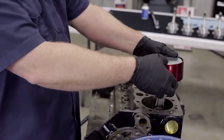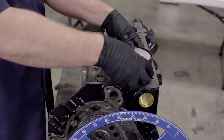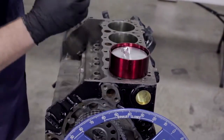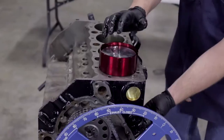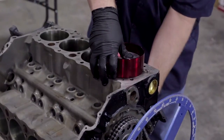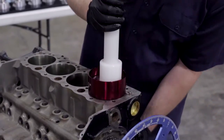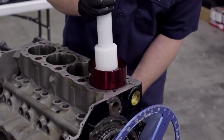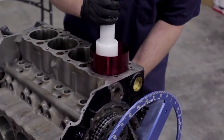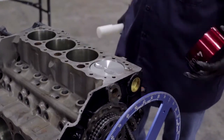The skirt will help us line it up on the cylinder. Now we're ready to pop in our piston — you're going to want to guide the bottom so that the rod doesn't damage the crank or the cylinder walls. If you bind it up, have a piston hammer on hand; just take your time, don't put too much force on it, and let it ease in.